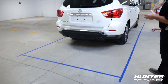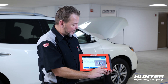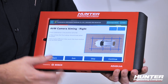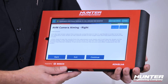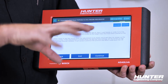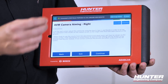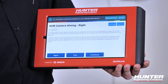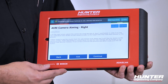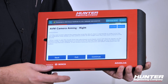We need to create a couple more lines on our grid. At each point E — which is our front tire — we're going to go back and create another mark, doing that on both front tires. The last thing it says to do is run tape perpendicular from the back wheel as well, so our grid is now fully set up according to the ADAS Link and the required measurements. It gives us a final interpretation of what it should look like when done — if you're not set up like this, press back; we're going to press continue. On the next screen we'll adjust the camera using axis X, Y, and rotate to line up the calibration lines on the camera screen to the target lines we created on the floor. When ready, push Apply, and the new settings will be written to the module.